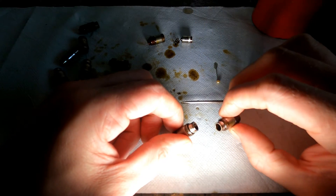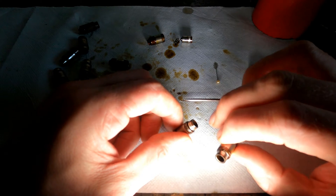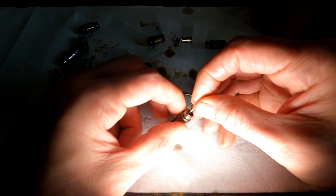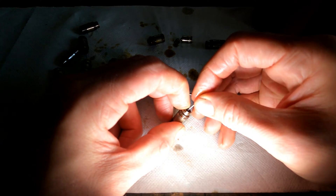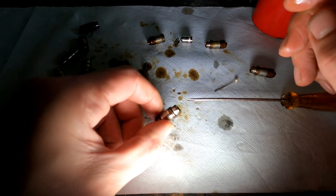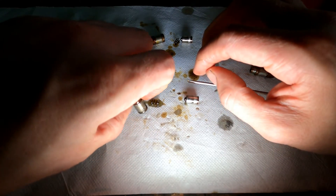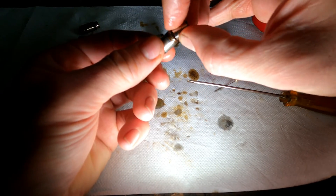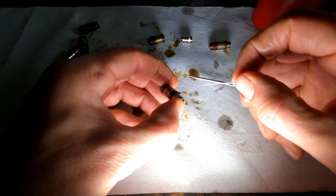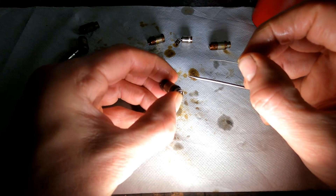But if you leave it like this and don't reset it, then maybe it is too far open already. So you need to have a base setting: only one drop of oil in it, as far down as possible. And that is how you place it back. So if we reset this one and leave some oil out of it, you can see if I push it I can push it inwards more. But now it is coming up — this is the reset setting because there is the spring inside. You can see there is oil in it so it is now rock solid. But if I empty this one completely so there is no oil in it, put the spring in there, you can see I can move it and it comes back because there is air in it. And this is how you mount it back.